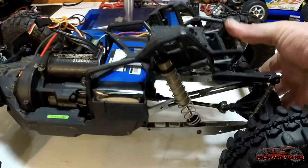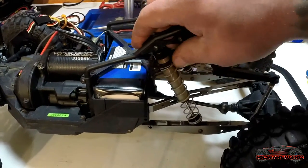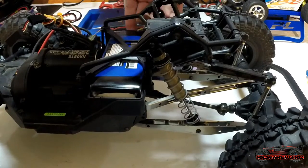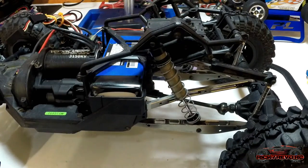You can always lighten or tighten the load with your preload screws — some shocks use preload clips. This is pretty much just fine tuning. Once you find a spring you like and you're happy with it and think it'll work well, this is when you start fine tuning.